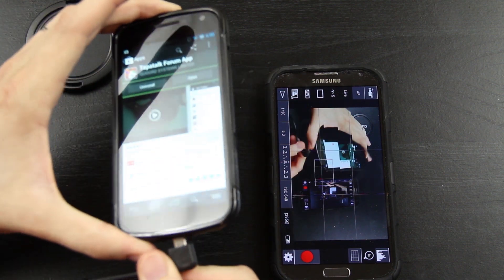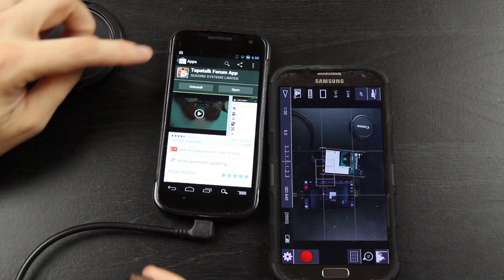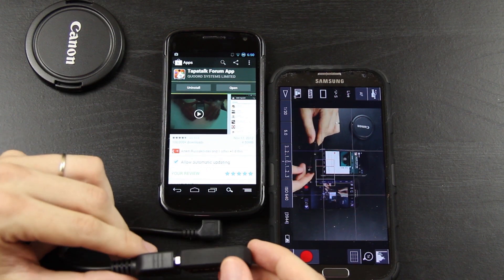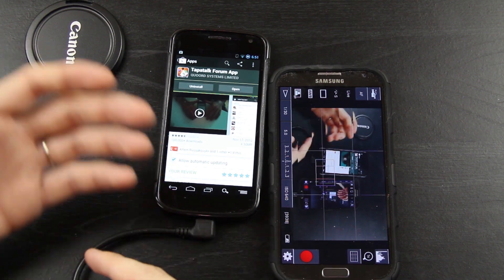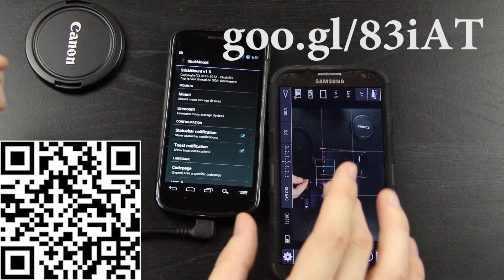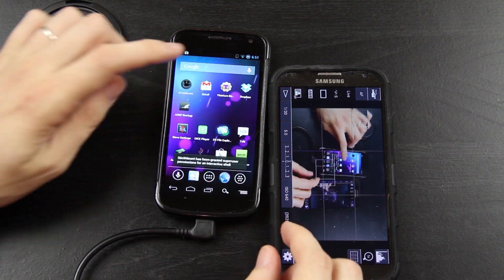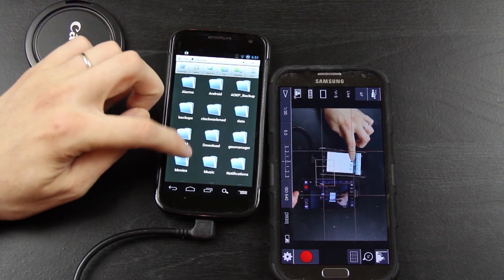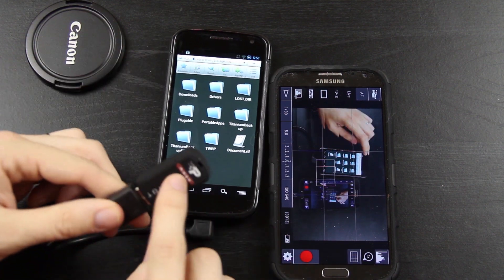It'll also work on something like the Galaxy Note 2. It'll say USB connected here in a second when I hook up this flash drive, and at the top it'll say preparing USB storage. Now I'm running AOKP, and even with AOKP and the stock ROM you have to download an app called StickMount from Chainfire. Press mount, and once you mount it you can go to ES File Explorer. You'll notice when you open ES File Explorer and go to favorites you won't see it — you have to go to USB storage, then SDA1, and there's everything that's on the flash drive.